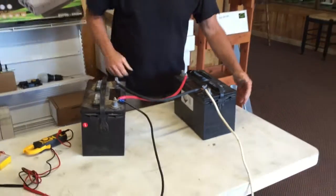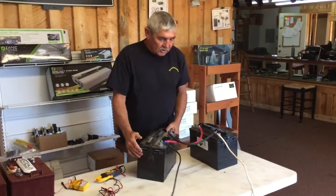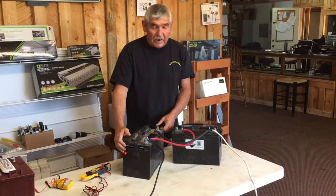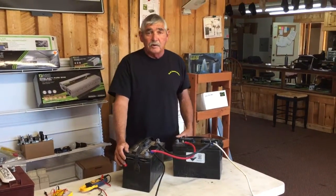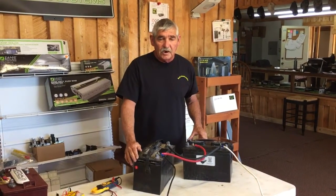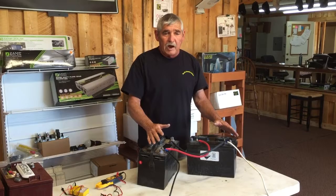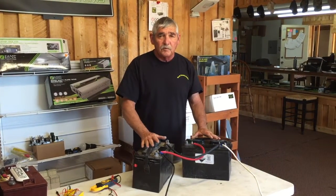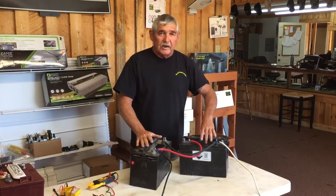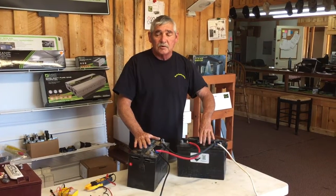A fine example is, if an RV comes in with two 12-volt batteries and it is hooked incorrectly, it takes about a day and a half, sometimes two full days, to get it fully charged back up and equalized — as long as the battery is still in good shape. If the battery comes in hooked correctly and we do solar, within three hours or so the batteries are totally full and equalized. After a day and a half of incorrect hookup, you are looking at having to put about 70 amps back into the battery to get it fully charged.